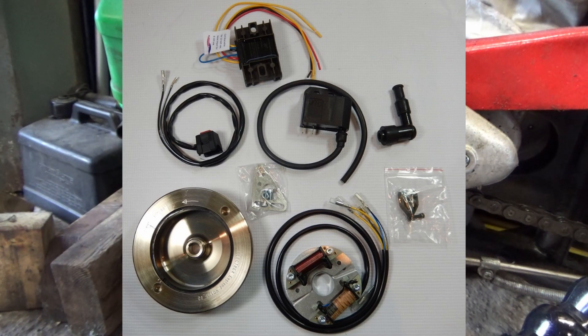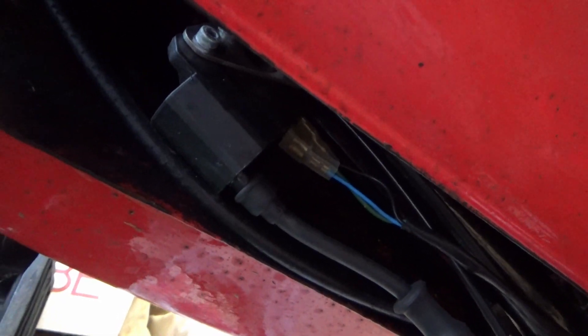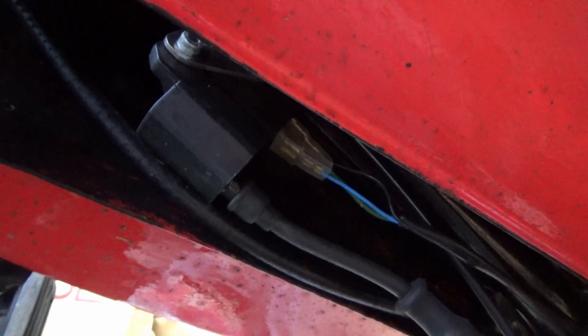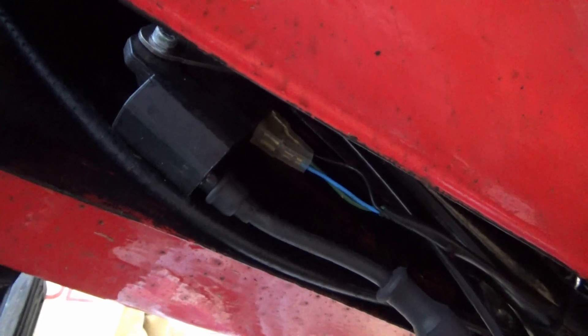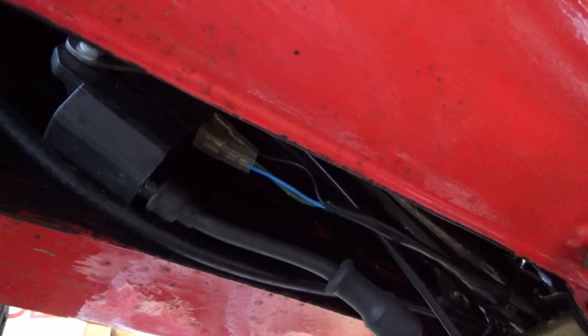The cable goes off to various parts of the bike. Underneath the tank we have the coil fitted, which I also believe is the brains for the system — it's a CDI system with automatic advance and retard. It's not brilliant; it doesn't give you a fantastic start so you do need to give it a hell of a kick to actually get her running, but when she goes she runs lovely.